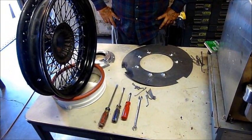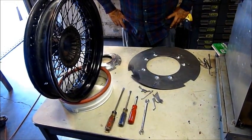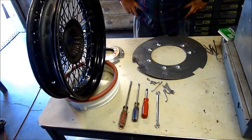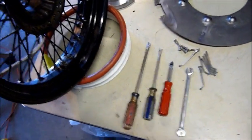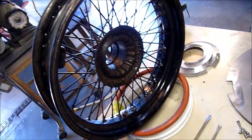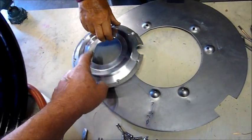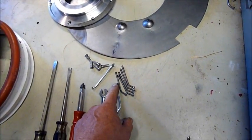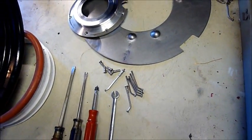What we've got here is a demonstration of how to install the backing plate and hub assembly onto a spoke wheel for Lamar disk. Let's start out by showing a couple of the tools we're going to use to put this backing plate onto the backside of the spoke wheel, retained in a sandwich pretty much by this aluminum hub. In between the aluminum hub and the backing plate, for our threaded rod, we're actually using spokes that are cut to a specific angle and a specific length for the purpose.